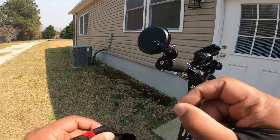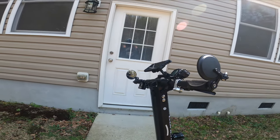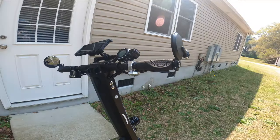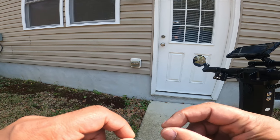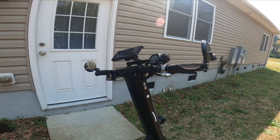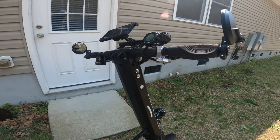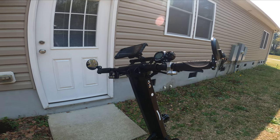I cleaned up the board, did a little light scrub with a brush, and after that, I probably tried for about 30 minutes to get those two tiny ceramic capacitors on that circuit board, heating up the end of the ceramic capacitors so that they could absorb a dot of solder. My biggest mistake from the start was trying to drop solder on the things, and I was creating cold connections, and so I was thinking that it didn't work.